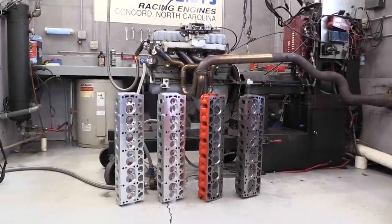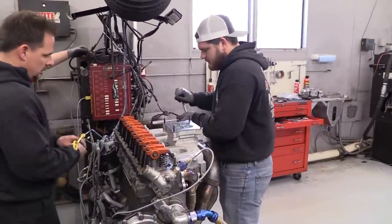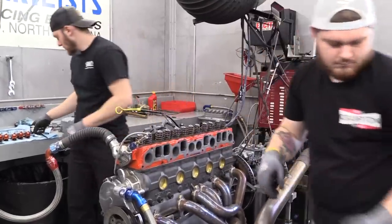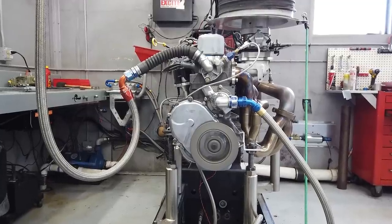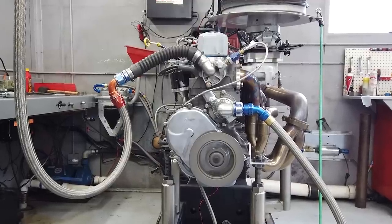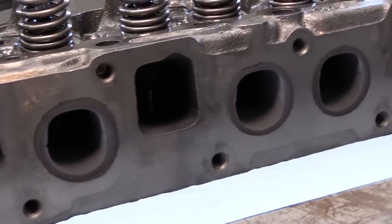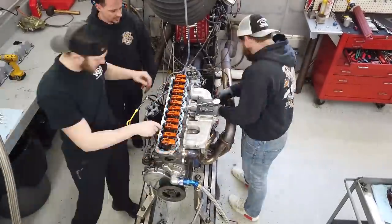So what did we learn? We learned that there is no single ideal cylinder head. The AMC and Jeep 4.0 Straight 6 is great at making consistent torque, but it resists efforts to significantly increase RPM or horsepower. So even the 15 horsepower improvement we saw between the stock bowl-blended head and the ported Edelbrock is pretty significant all things considered. If you're running a stock short block, your best bet is likely a stock head with a good set of valve seats cut into it — this will provide the best torque down low and drivability. But if you're going with a stroker combo, a big cam, or other upgrades to make power, this proves that there is a lot you can do with the cylinder heads to improve both torque and horsepower. Most important of all: go burn some gas and have fun. Thanks for watching.